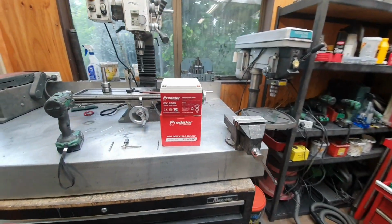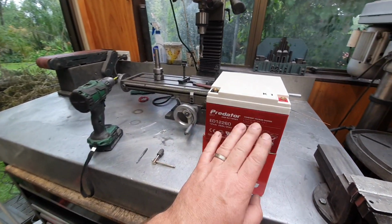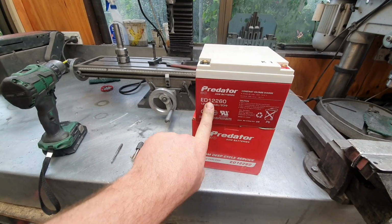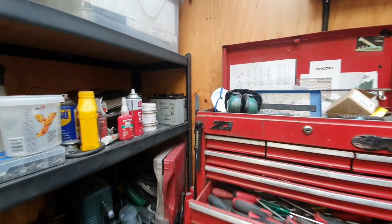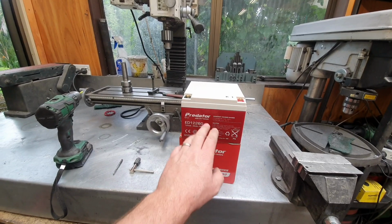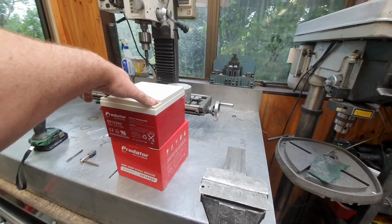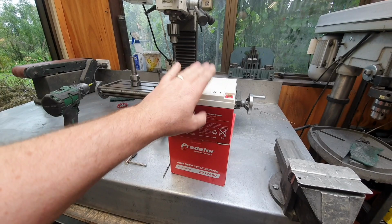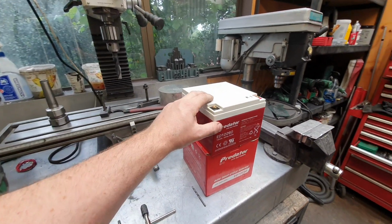We got ourselves a new battery, thanks to Stuart Fox from Wairau Mufflers and Brakes, I think his business is called, something like that. I made the mistake of saying this was a 60 amp hour battery in the previous video. It obviously isn't. I mean, it's got a 6 in the number, but it's definitely not 60. So it's not 3 times bigger than what that one there was. These are 22 amp hour, those little wee ones there. And that's 26 amp hour. So it's not a significantly bigger battery, but it's an AGM style battery rather than a lead acid one. And you can see just from the size of it, the plates and everything, its ability to deliver the voltage at higher amperage is much higher, so this should do the trick. The problem being, of course, it's an ugly colour to put in front of the car, but never mind, we'll get around that. I have a plan.